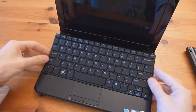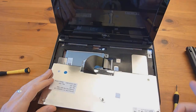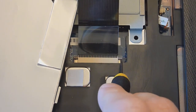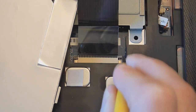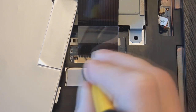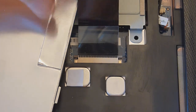There's one there and one there. Take the keyboard, pull it out slightly, and bend it back. Then what we need to do is remove this ribbon cable here. Simply push this way on this little gray piece and that little gray piece, like so, and do it very carefully — you don't want to stab the motherboard. Just pull them out, and then the ribbon cable should just slide right out.